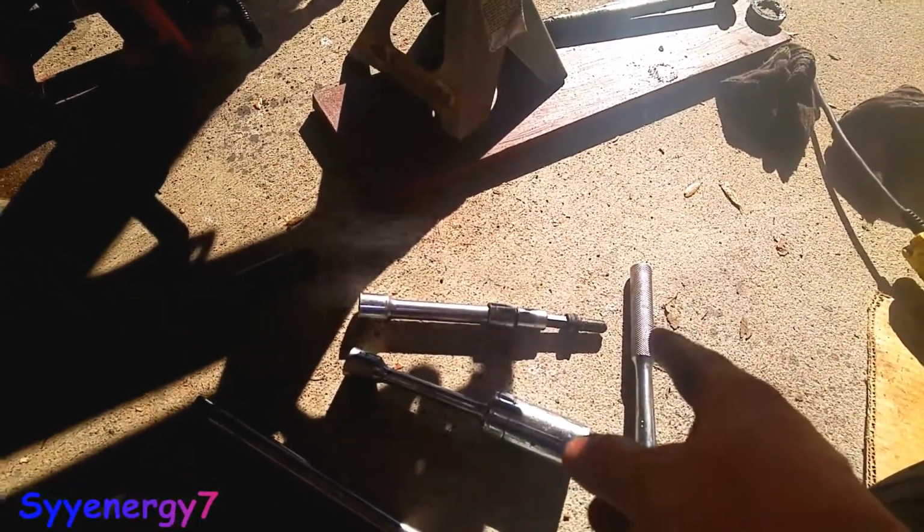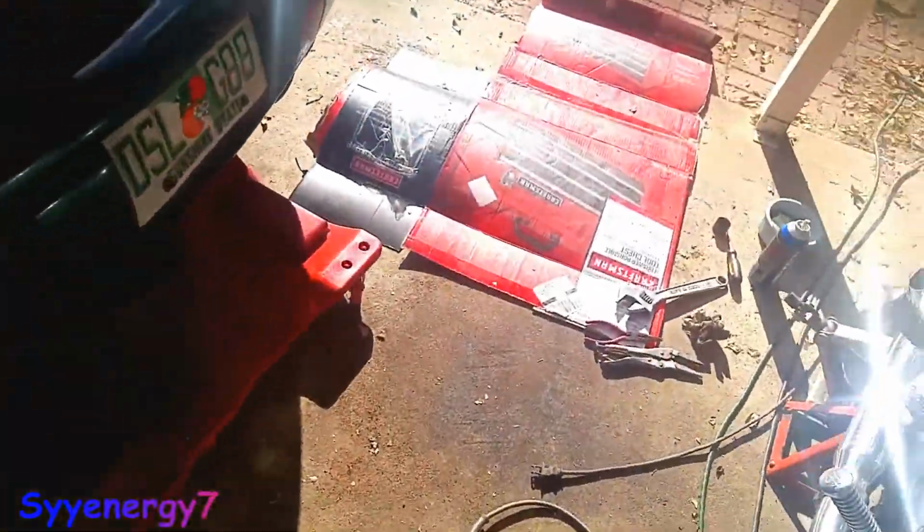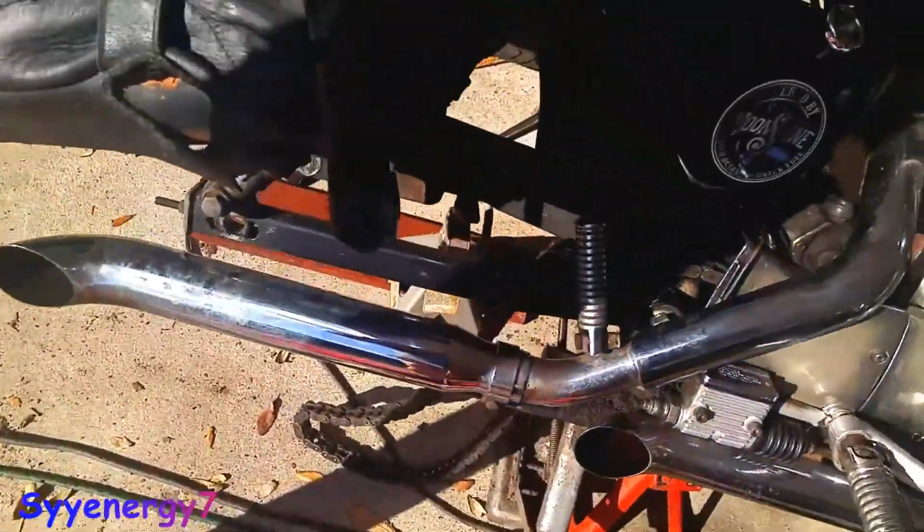I forget what that bolt gets torqued at. I think it's 50 foot-pounds, and it's got Loctite on it. But what I was hoping to do, I'm going to do something else. And somebody will say this is Mickey Mouse, but I don't really think so.